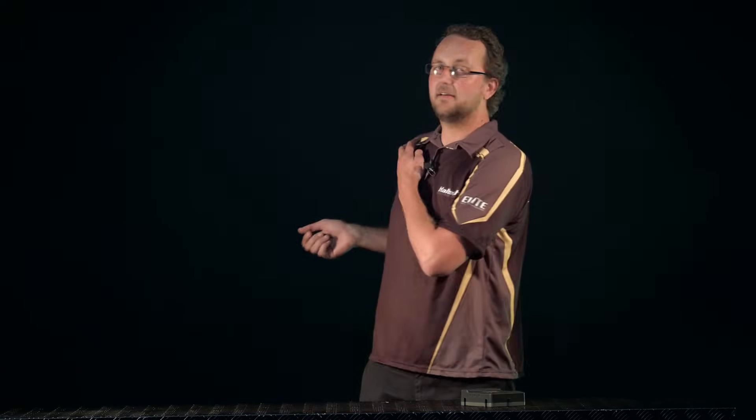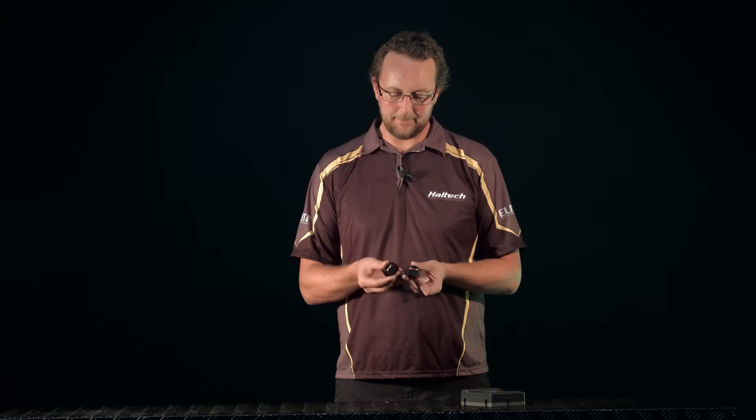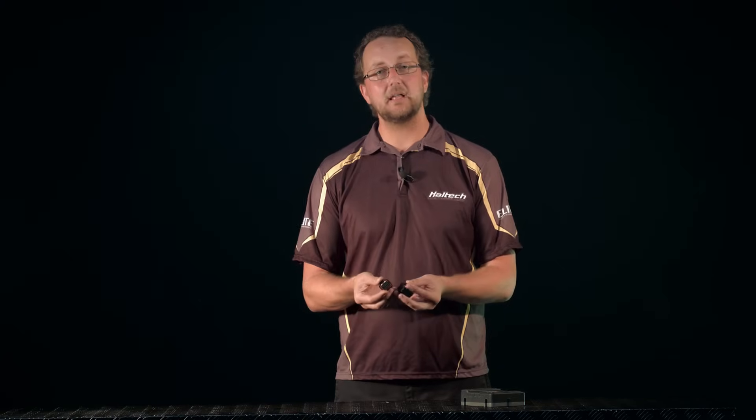If we don't have a patch harness for your car, we've still got plenty of wiring methods to go through. The next one is the plug and pin set. With a plug and pin set we've got our AMP ECU connectors supplied as the plugs and pins — as the name suggests. Using this method means you've removed the factory computer altogether, cut the factory ECU connector off, crimped the Haltech pins on, repopulated the AMP connectors, and you're ready to go.